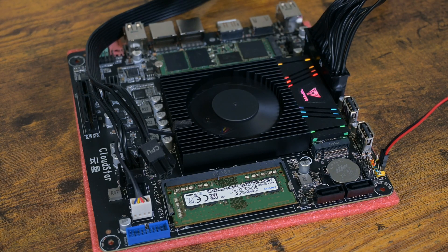Finally, the fan noise was acceptable. Its minimum speed is 2400 RPM. Thankfully, the fan is slightly larger than what you find on these kinds of motherboards, and therefore less noisy. The smart fan feature in BIOS is quite comprehensive, but the minimum RPM is 2400. You can use those low-noise adapters from Noctua fans — I found that each one reduces the fan speed by about 200 RPM. Daisy chaining four of them made the fan almost completely silent.